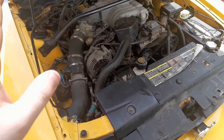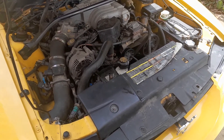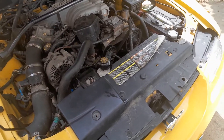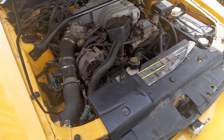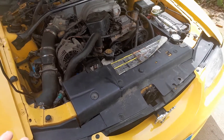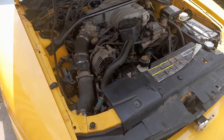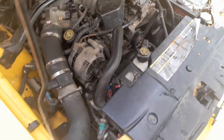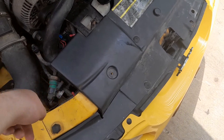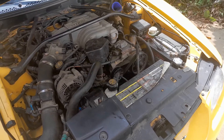There's no switch on mine, so whenever I turn my ignition on, it kicks the fan on high. As soon as the ignition is on, the fan is on; whenever I shut the ignition off, the fan is off. You can kill your battery if you're sitting somewhere listening to the radio, because the fan's still going to be on. So it would be better to put a switch in line of this ground — ground it to anywhere in the car that's a good ground source — but I don't feel like doing it right now because it's so hot.